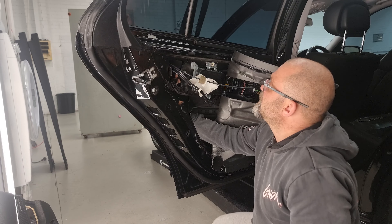What you want to do is pop that in through here and once you locate it - because I've done the other side - it's about 11 quarter turns. The reason why I was counting is because you can actually wind it out too far, and it stops you from getting out the little release thing on the back of the handle. So we'll just count: one, two, three, four, five, seven, eight, nine, ten, eleven.